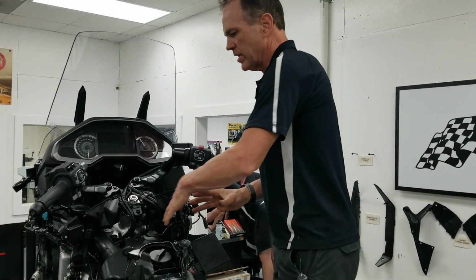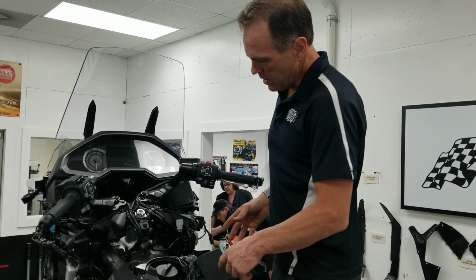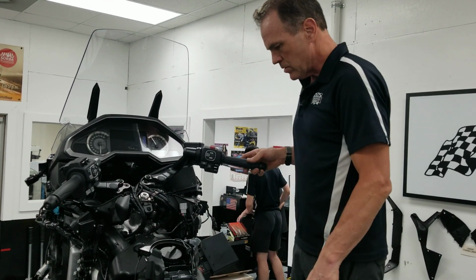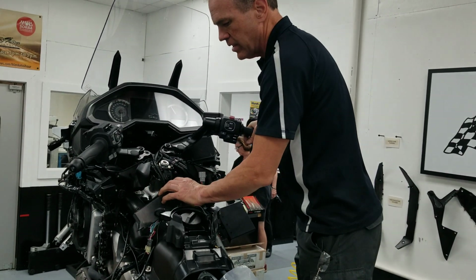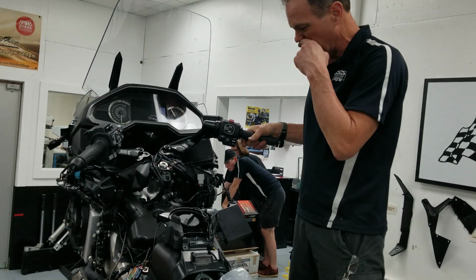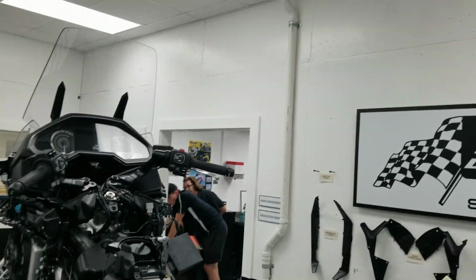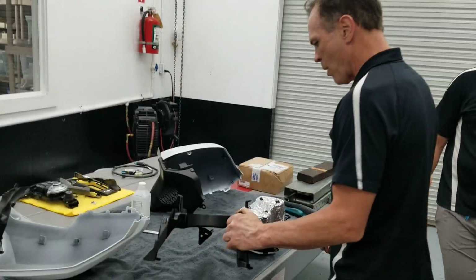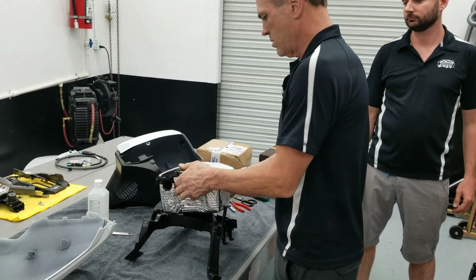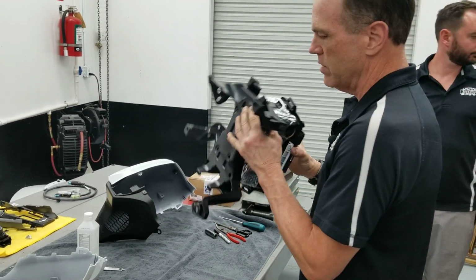But basically, there's a lot of electronics you have to unstrap from the side of this mounting frame, and then tons of wiring harnesses are clipped to it all around everywhere. And then on DCTs, there's some kind of delicate wires. I have no idea why they're all exposed like this, but they are, that you have to be careful of to get this out. And then what happens is we get this frame out over here, that your air box sits in, something like this, and when you turn it over, there's 4 screws on the bottom that you pull out to remove the air box.